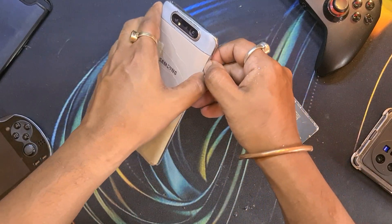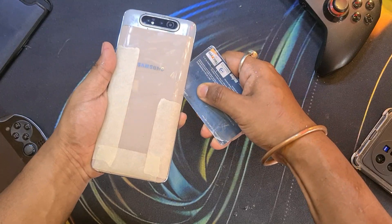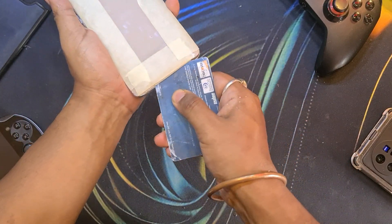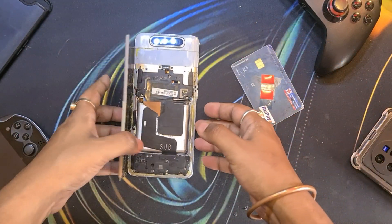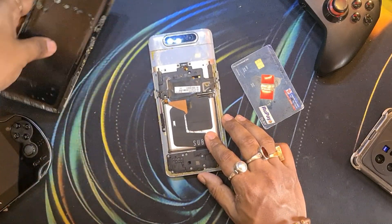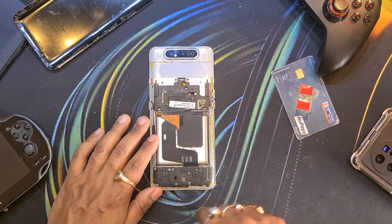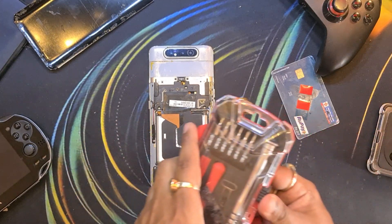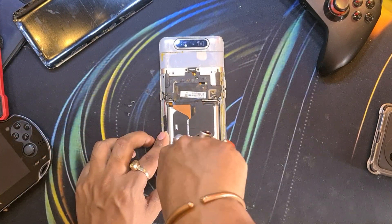Now let's start by opening up the back glass. You can see the tape around the back glass — it was fixed so that the glass shards, because the back glass is also broken, do not go everywhere. As you can see the back glass opens up and we are greeted with the inside of the phone. We have the battery fragile flex cable, so be very careful while poking around with a flat piece of plastic, a debit card, or spudger while opening the back glass.